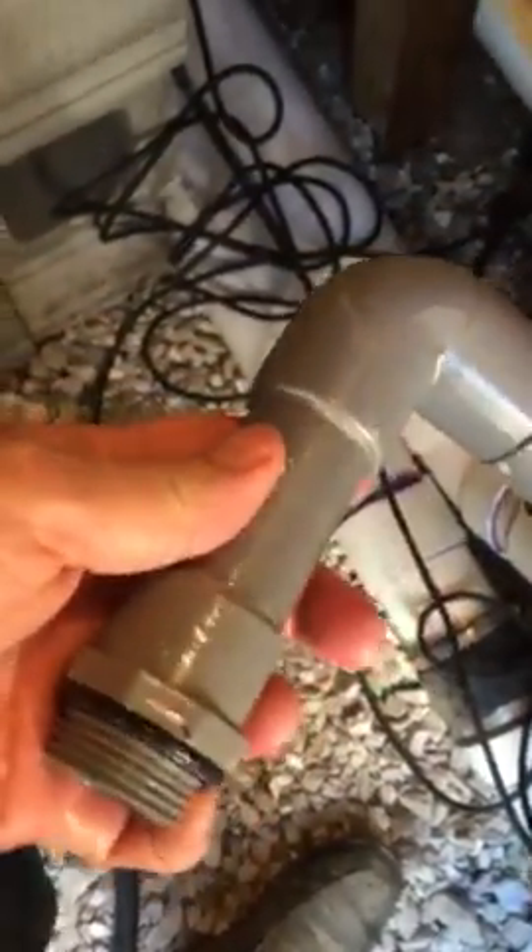It's coming off right here, so you can pull this out of the metal wall and the Hunter valve is attached right here. This gasket is what is keeping the pipe from leaking against the metal side. There isn't any gasket here against the Hunter valve, and so all three of mine — this is a place where water has been leaking underwater whether the spray bar was going or not.